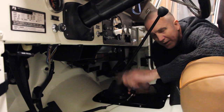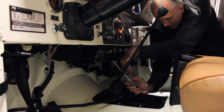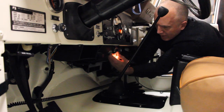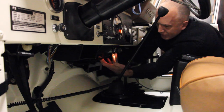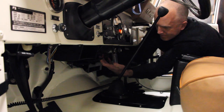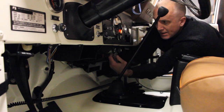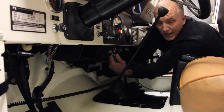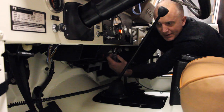When you connect to the A terminal — the voltage supply to the temp gauge — it should flash at almost the exact same brightness, about a second apart. If it stays constantly bright and doesn't flash, that means you have a problem within your regulator inside the gauge — it could be a bad ground to the gauge, or the regulator arm inside might actually be stuck. You'd have to take the gauge apart and see if anything's moving. If it doesn't light up at all, your gauge is bad — you can stop here because the gauge is toast.